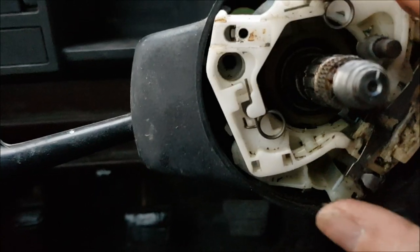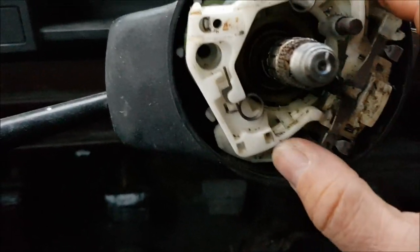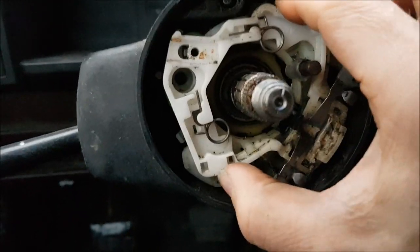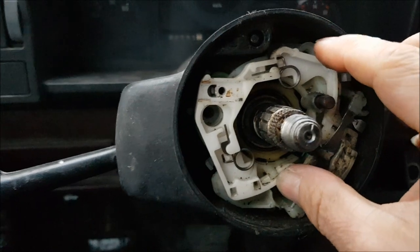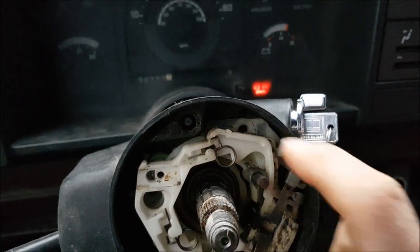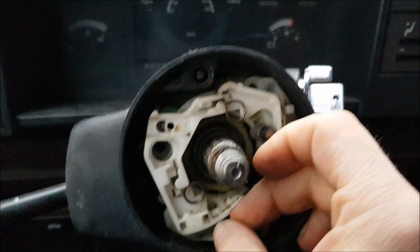This is your turn signal switch. That pin right there is hot — be careful about that, that's your horn switch. We just fit this back down in here gently like so. It sits in there and there are three screws: one down here, one up there, and one that sits underneath this switch, and I'll show you that in a second as I get these guys back in there.